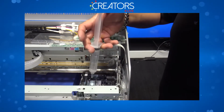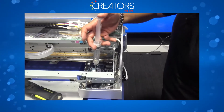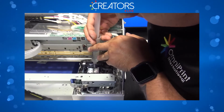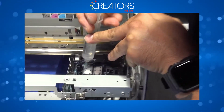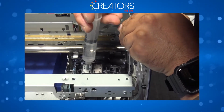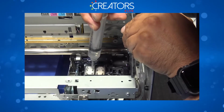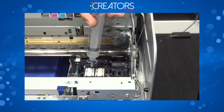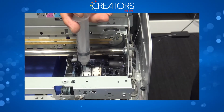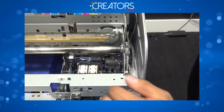And now we're gonna go ahead and do power down. We're gonna press on the control panel, power down, like if we're gonna prime the lines. Then we're gonna squirt water to flush these filters. There we go. We're gonna press power to stop. Always grab your towel. Protect your printer from drips.